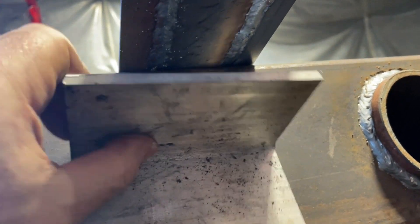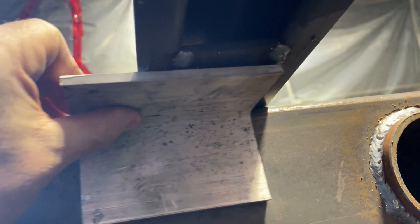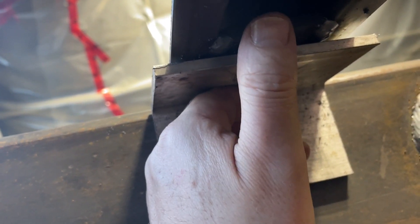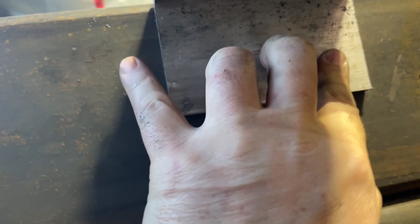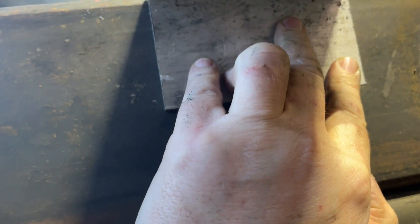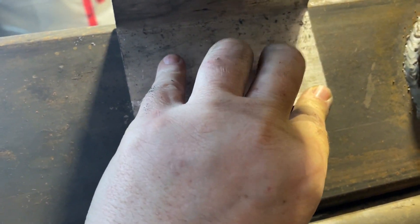The welding bead isn't ground yet. Basically what I do is use an aluminum angle — I put it on there and there will be a hole where my thumb is — goes all the way through. I stick a bolt through because I can reach in there and stick a bolt through, then a self-locking nut here. And on the flange of the subframe, I drill two holes and cut a thread because that's a six-millimeter wall on the subframe, then put one or two bolts in there.